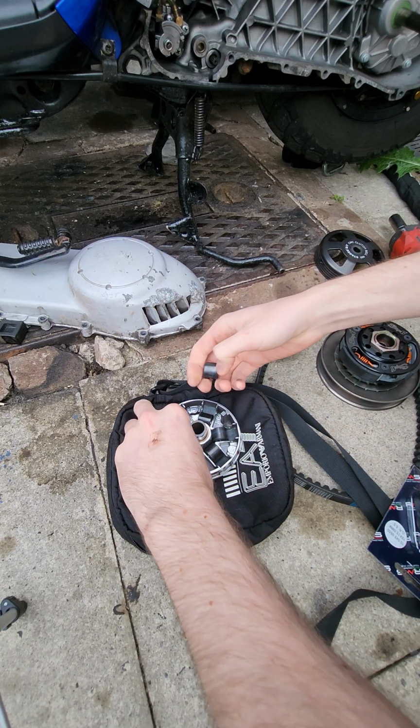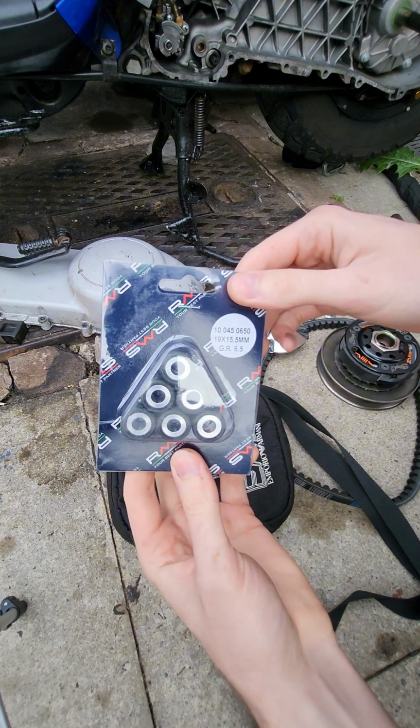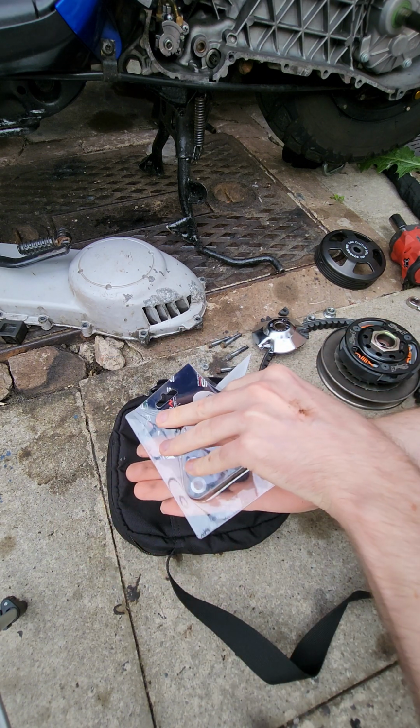So before we did the 70cc engine build, we was running a Stage 6 medium contra spring, 5.5 gram rollers in a Polini variator, and red clutch springs on a cheap adjustable clutch. And honestly guys, this was fine, it was perfect. Even when I did the 70cc engine build, I kept the CVT the same and it was fine.